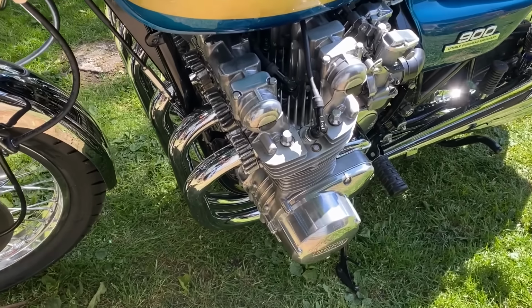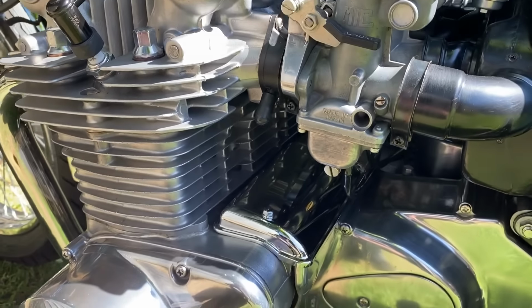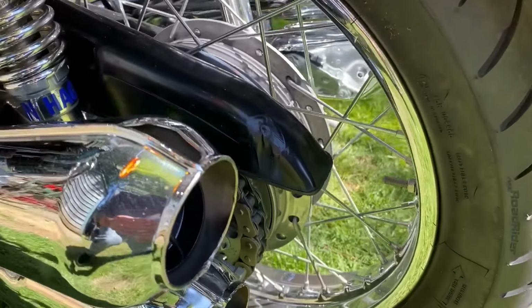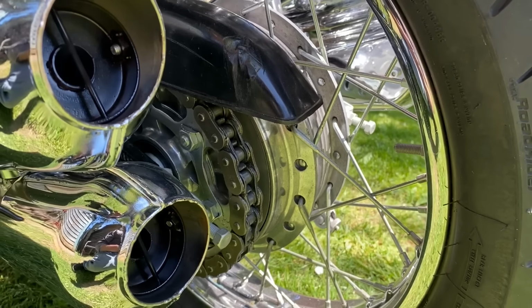I've just got back and I'm really pleased there's no oil leaks whatsoever anywhere, but my gearing is awful. This back sprocket is a 33 tooth. It's the smallest I can buy online, so I'm going to have to make one. When I made my V8, I made a 30 tooth. I think that's what I really need.